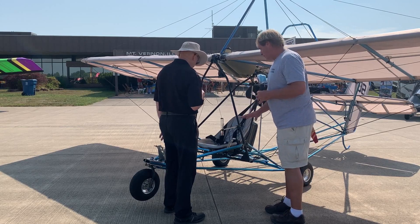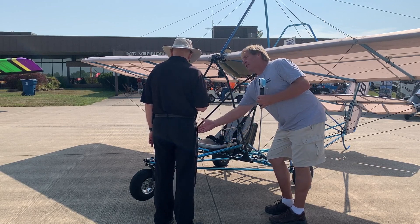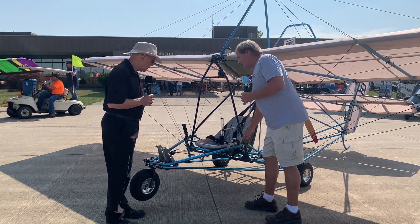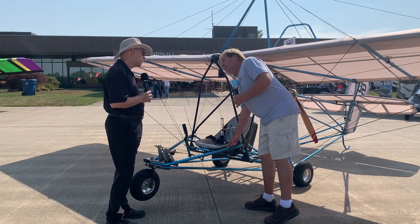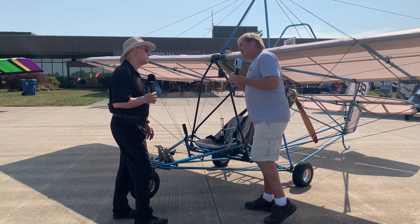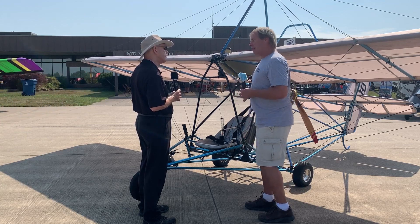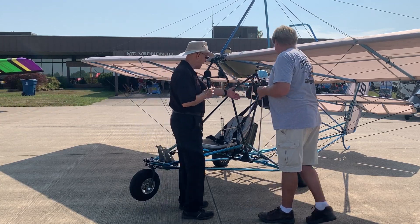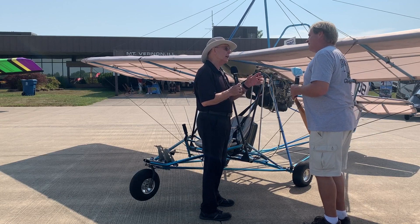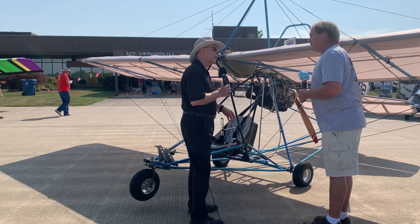They had to modify steering and pedals — when they lowered it, they couldn't use the gooseneck because everything was lower. So they modified the gooseneck, changed the angle, used a little bit bigger tubes to add structure. Because a lot of times with two-places, they were going out and making these chromoly to get them stronger. Now they decided let's back off of that, because chromoly breaks — aluminum bends and it's heavier. So this will bend and not be pieces; it'll still most likely stay together if something happens. That tube right back there, the landing gear support tube, bends sometimes — aluminum does that. It'll bow and give, you can still taxi back, no problem. But obviously replace it before you fly again.